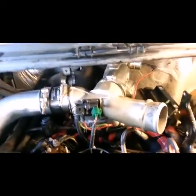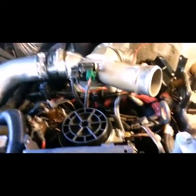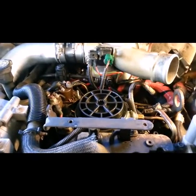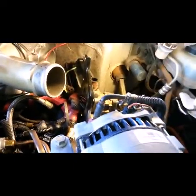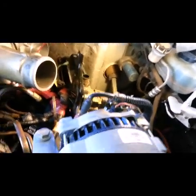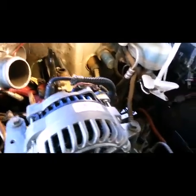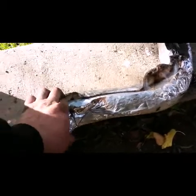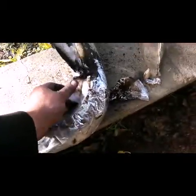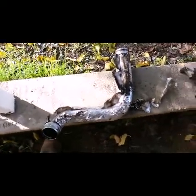Alright, it's almost all put back together. I just got a couple intake pipes left. Also, I wanted to say — once you're in here, there are a couple other things you could do, like the intercooler pipe that goes from the turbo to the intercooler. A lot of these 7.3s, it's wrapped with a foil. You can do a foil delete, which is just taking the foil off the pipe and cleaning it up. All you do is just rip all this aluminum off. It's just there for sound control; it doesn't really need it. You might hear your turbo spool up a little bit more, but as long as you don't mind the noise, it'll look a lot cleaner.